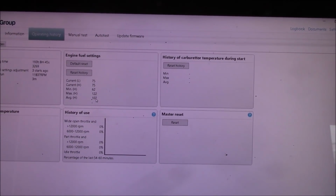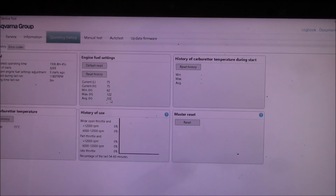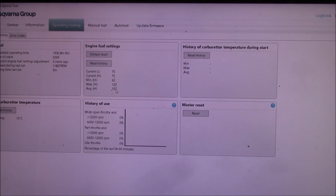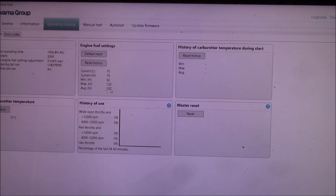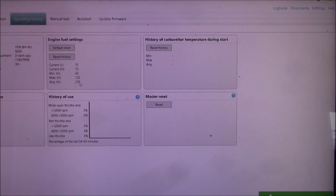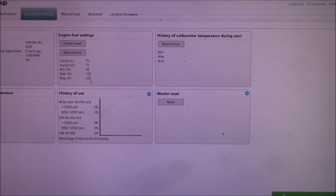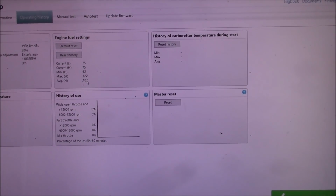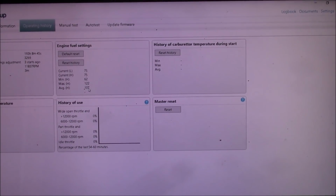But what's really of interest to most of us is the underload. But also it's the essence of what Autotune's about. And basically what happens is when you're under full throttle or close to full throttle, every couple revolutions the system does what's effectively a lean out test. That's what they call it too. And basically you have this little shuttle valve. It opens and closes at a fairly rapid frequency based on the firmware in the system, and how long it stays open versus how long it stays closed determines how much fuel is available to the carburetor, so it effectively leans or richens the mixture for the saw.